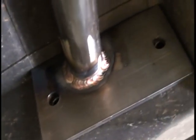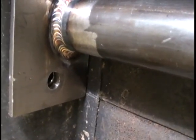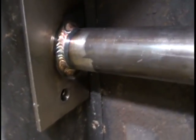Okay, now we've got the bar in place, and all you got to do is slide it between the frame rails where it fits. Slide the flat bar all the way back against the existing brace that runs between your frame rails on both sides. Just butt it up, make your mark on your holes for your drill, take it back down and drill your holes. We'll do that now.